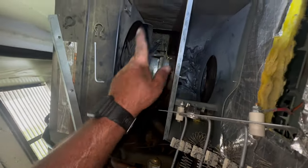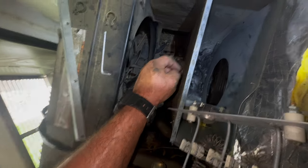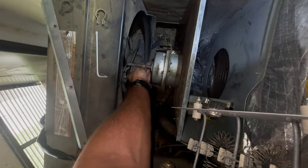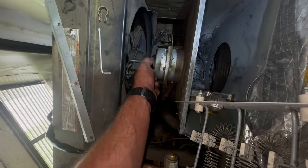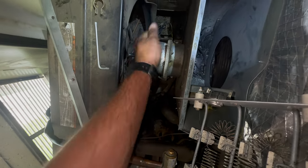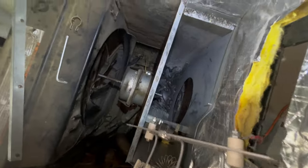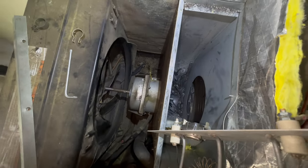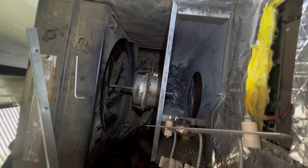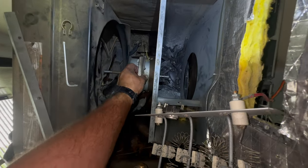Before you try removing that wheel, make sure you don't try to pry it because it will snap the wheel. This is all one single shaft and it's connected. I was able to grab my channel locks on one side to keep the shaft from spinning, then you can just get that wheel and wiggle it back and forth and pull — it'll eventually work its way off. It's just going to be a little time consuming. Let's get this motor out and then I'll clean out all those pieces from the housing.